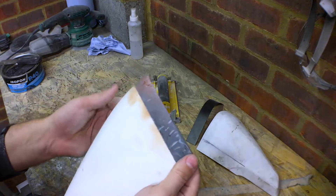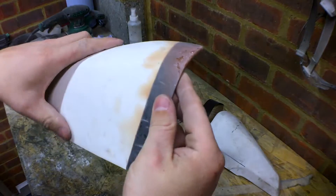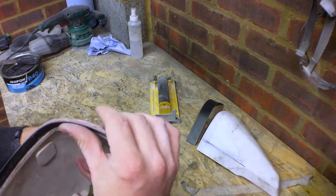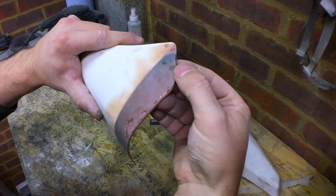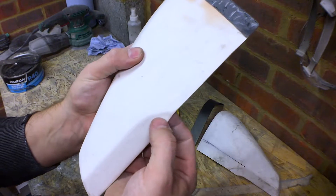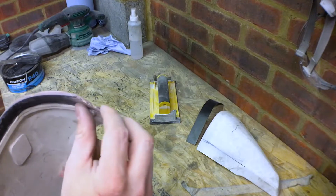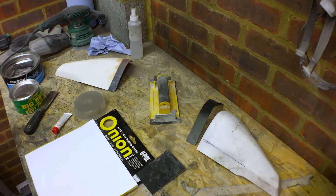Right, so that's as much as I'm going to get on there. You can see from the thickness there what it started at and what it's got to now, just to get that contour right. It's not a big deal — as I say I'm going to cover this, either make a mold of it or cover it in carbon fiber, at which point I can decide. But I've got to get the shape right. There are still low spots and this edge isn't quite perfect, and there's a nick in there — just a couple of rough bits. So I'm just going to get the standard body filler out now and tidy up all the little edges.